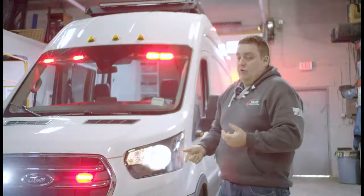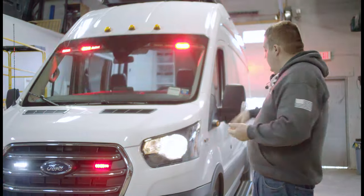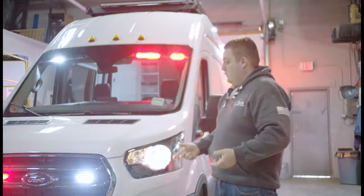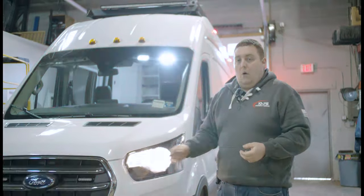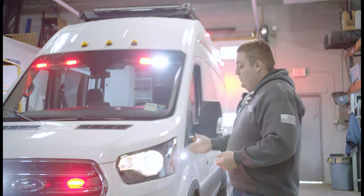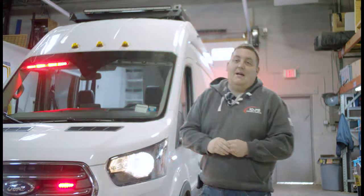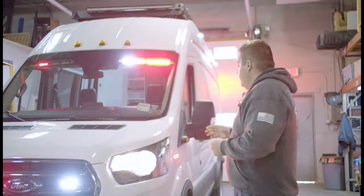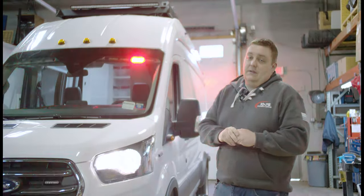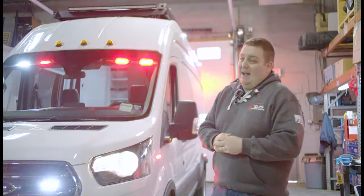Taking a look at the vehicle now in its drive response mode, we have our white flashing and headlight flashing. The truck features SoundOff's Blueprint system, which gives us control of all the lights, the OBD2 reader, reverse park turn signals, and anything we'd want to improve the functionality of the electrical system. It also allows for cleaner wiring and makes it easy to add adjustments or improvements to the vehicle over time without tearing the whole thing apart.